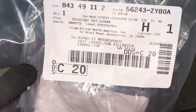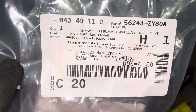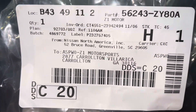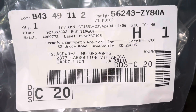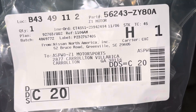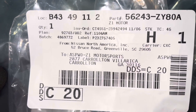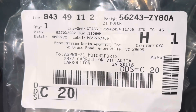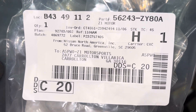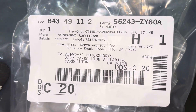That's the part number for the bushings if you guys need it — it came from Z1. I couldn't record everything but most of what you guys need was recorded so you can see it. For the sway bar itself the bolt is a 16 millimeter socket. For the sway bar link it's a 14 millimeter socket. You have to use a vice grip to hold it so the bolt doesn't spin in the back. When you put it back in, depending on the sway bar you get, you can use a 9/16 spanner or an 18 to hold the bolt on the back when you install the new one. For the new one, you cannot use the vice grip — it will damage the new rubber seal that's holding the grease on the inside. Thank you guys for watching, please subscribe.